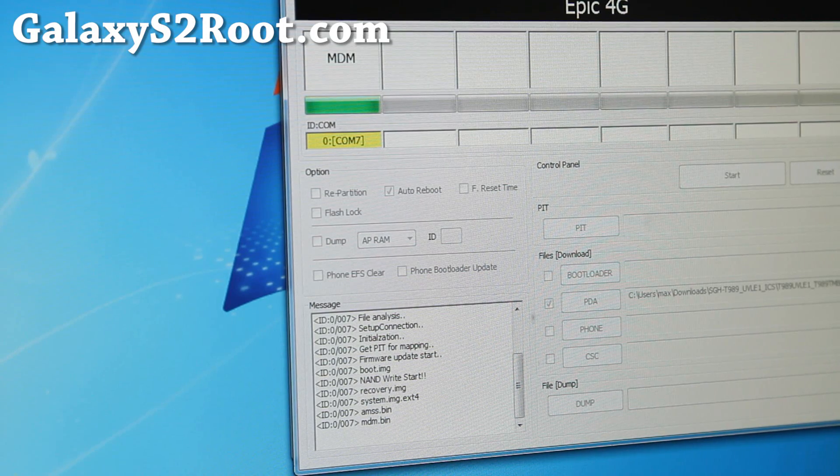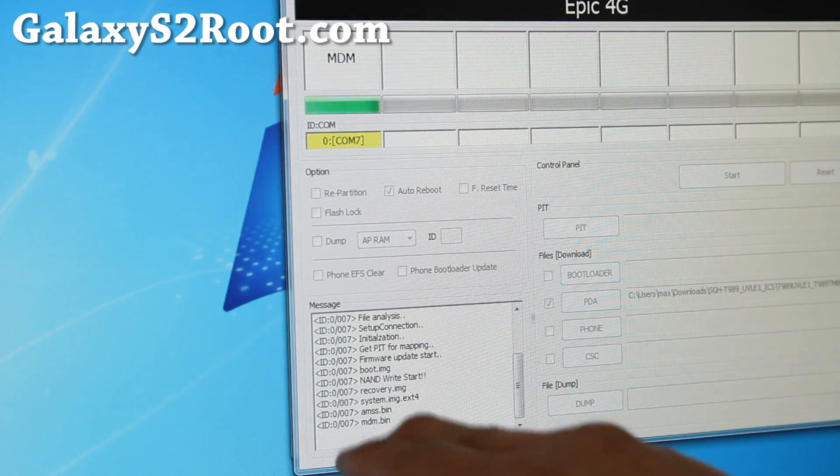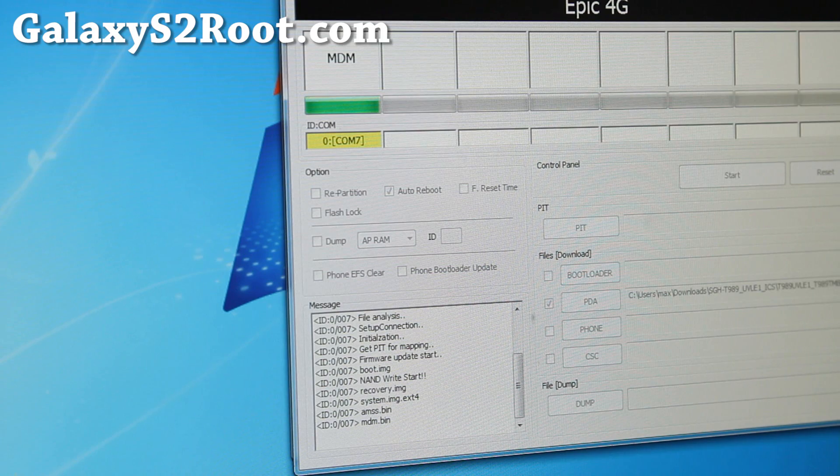You don't have to do the factory reset — you can do it later. I'll boot first and then show you how to do a factory reset for those having trouble after unrooting. The MDM, boot image — that's your boot image. The thing that boots recovery is the stock recovery. System is the whole system. MDM is the modem. AMSS — I forgot what that is, somebody can help me out. By next week I should have a bunch of great ICS ROMs with the official updates, making T-Mobile custom ROMs more flawless.